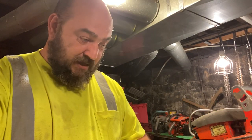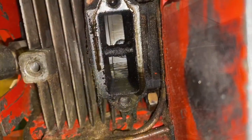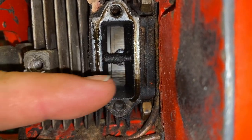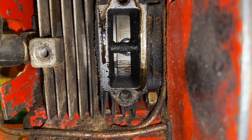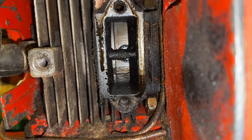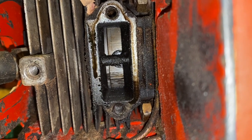If you can find a $50 saw with a good piston and cylinder and electronic ignition, you're golden. Don't worry about whether or not it runs — worry about those main points. Also make sure the saw is complete; you don't want it to be missing parts. Now let me show you inside this cylinder. You see how the lines go straight this way? That is scoring — we cannot have that. Whenever you look for a saw, you want it to be nice and smooth in there. If you find one with scoring, be prepared to replace the piston and cylinder. I'll have to do it with my saw.